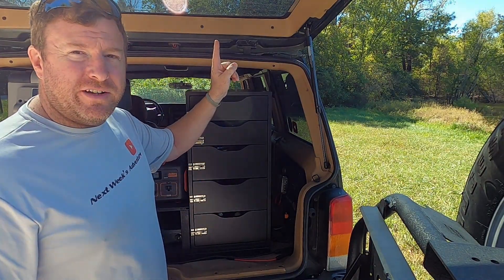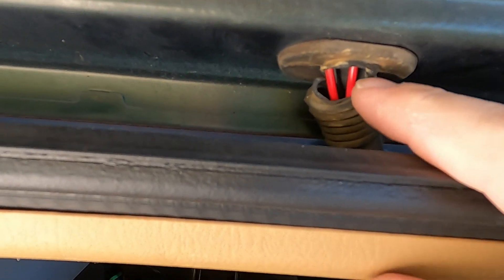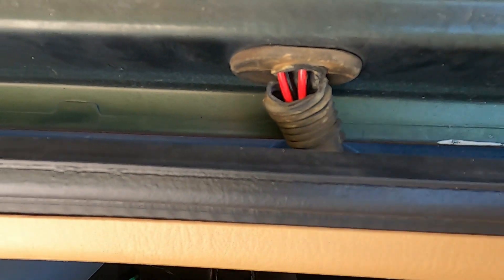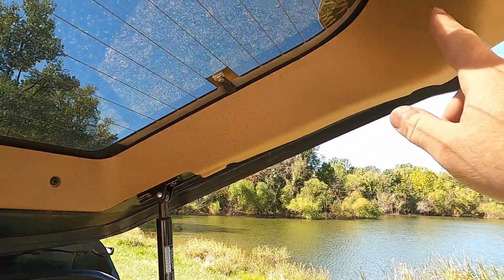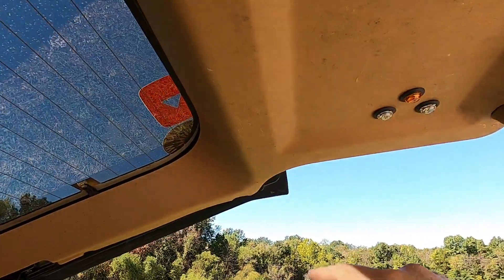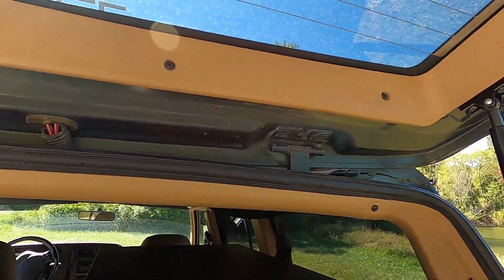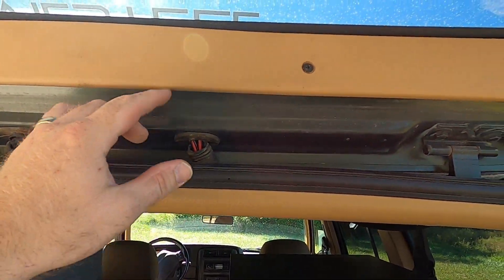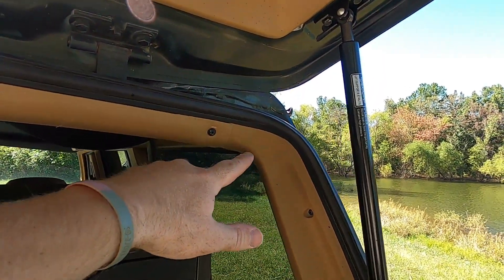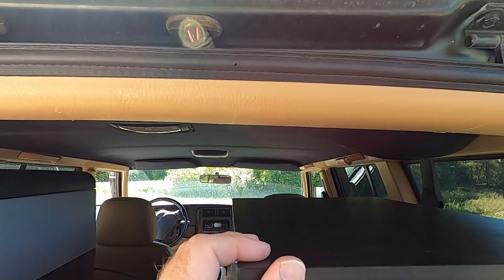For up above, I took the wires from down here and chased them back up, then came across the top. On the typical Cherokee the weather seals are bad anyway, so I chased the wires up through the gap that runs all the way around the edge, and up in there there's plenty of space. I tucked all the wiring up in there, wired the lights on both sides, and wrapped everything in that same loom wrap material I use on the roof wires. Anywhere where wiring is rubbing on metal — especially in corners — I cut a small section of the wrap and put it on to protect the wiring.